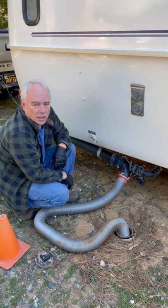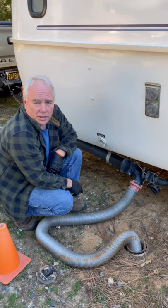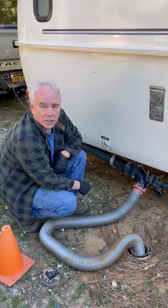On the Casitas it takes somewhat longer to drain the gray water. The main thing I do is make sure that the trailer is leaning in this direction towards the outlet. Then close the valve and raise this up.